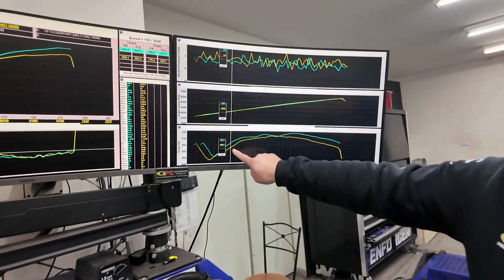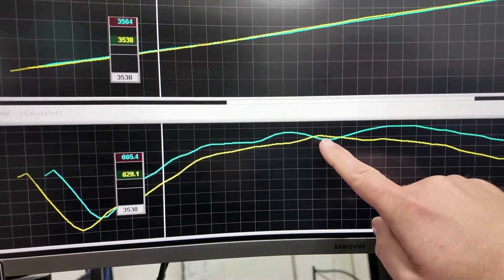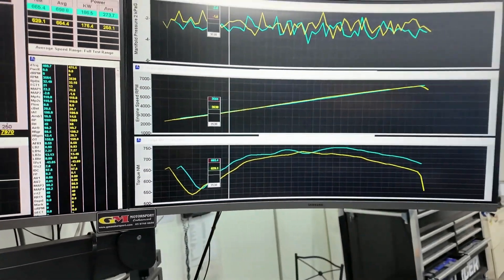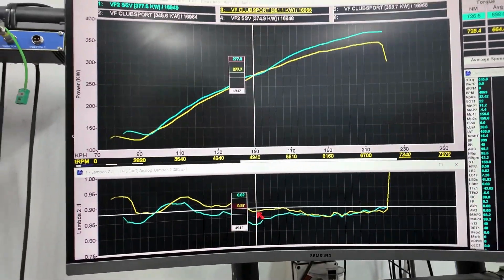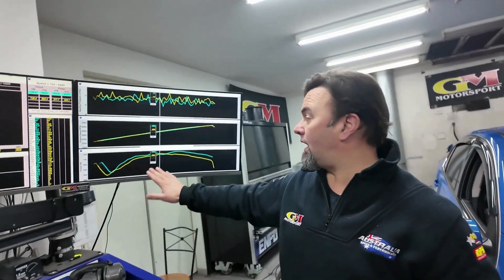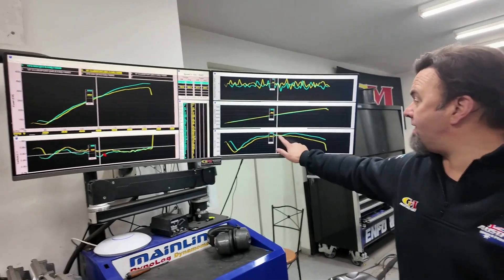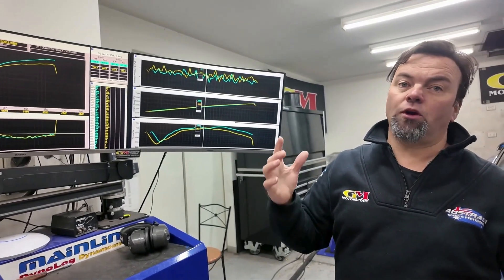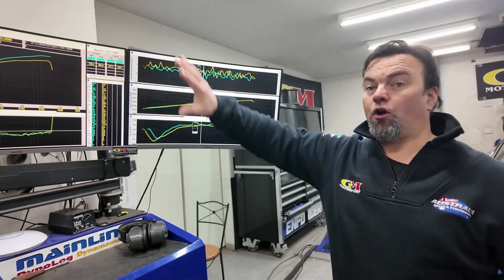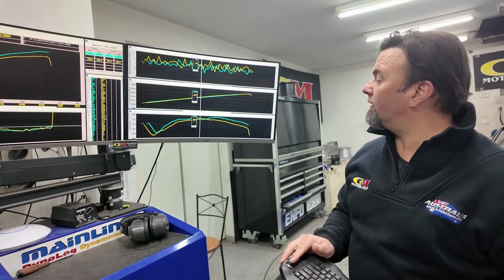Look here from the get-go — the torque, more torque all the way down. Interesting enough, the torque virtually meets at that point here. To be a bit fair and transparent: with the CNC head we probably could have touched the tune-up — you can see we are a little bit rich in that area. We could clear that up. We're being very transparent saying hey, we probably could have had that carry through, but at some stage you might see them cross over with velocity. That's why the flow bench is great, but the engine dyno overall is the result you want to see.